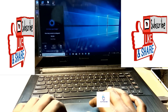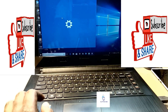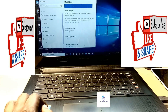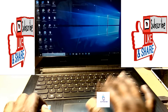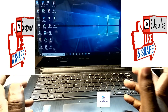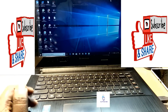But you can manage without the keyboard just by double-clicking on the touchpad. Let's re-enable it: go to mouse settings, change your mouse settings, touchpad, additional settings, enable device, apply, OK. So that's the way you can easily fix your touchpad issue on your laptop. If you liked this video, please click the thumbs up button and don't forget to subscribe. Thanks for watching.